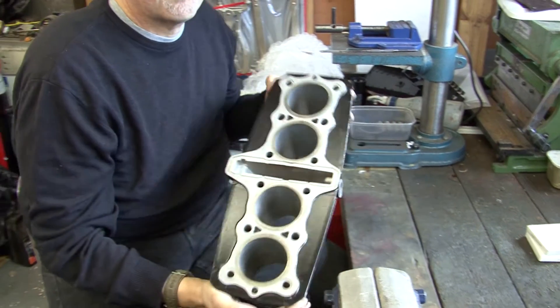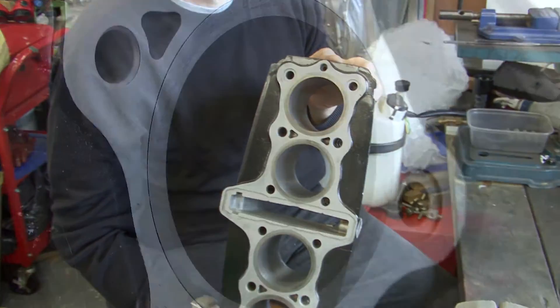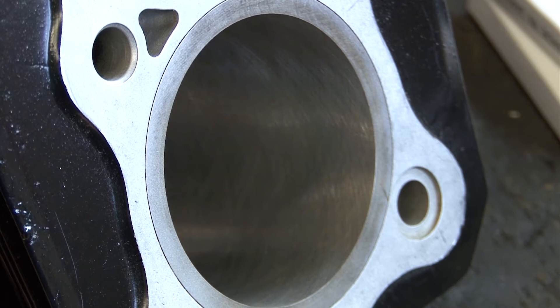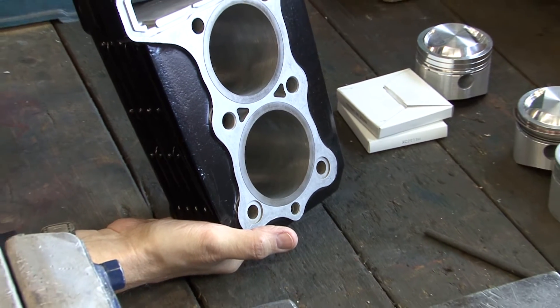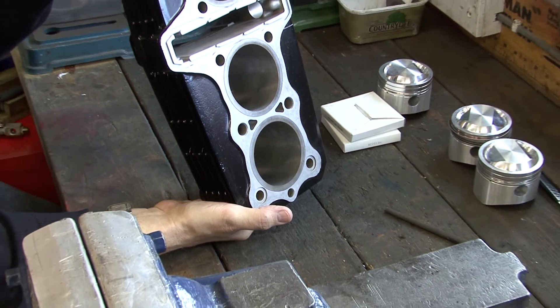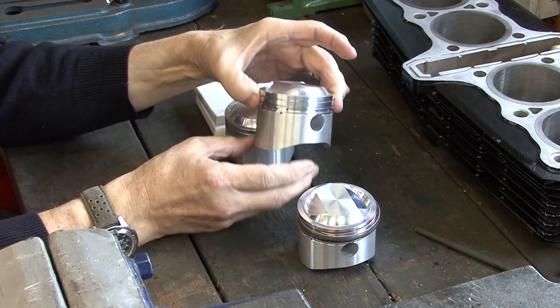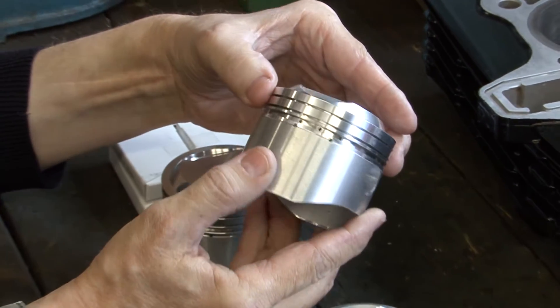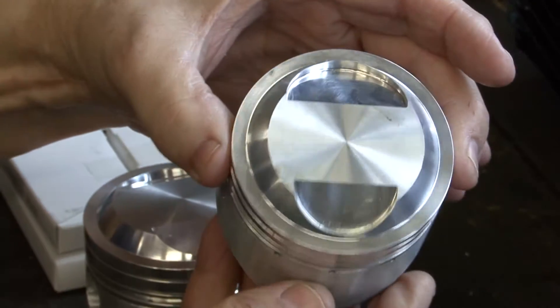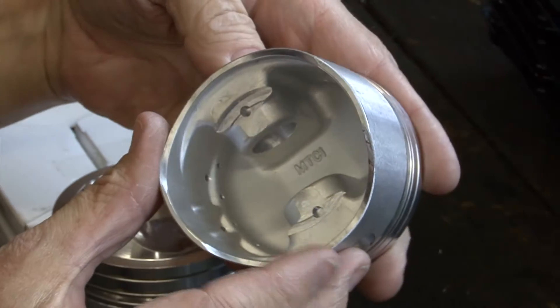Hello, I'm John. This bike smoked like a pig so the barrels have been rebored. You can see the crisscross pattern of the final honing following boring. Because you simply can't buy original oversized pistons for a bike this old, I have elected to fit a set of MTC high compression pistons made for performance engines. I'm not looking for extra power but you have to work with what is available. On some bikes you have to be careful about the effects of the extra load, but these old Quacker motors are bomb proof.